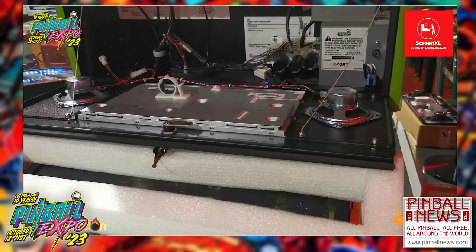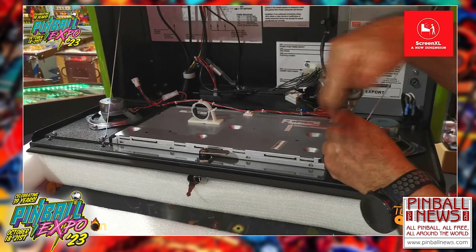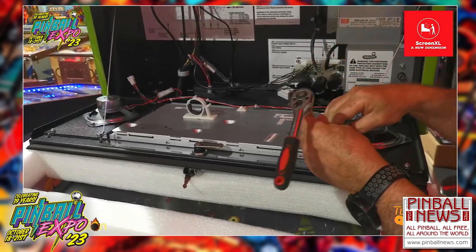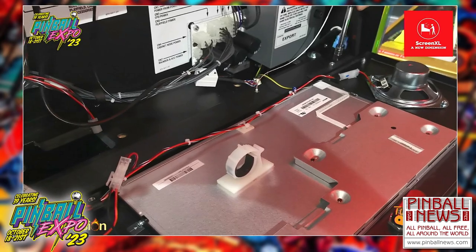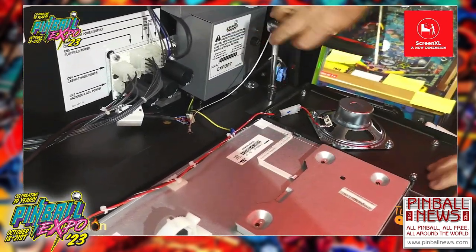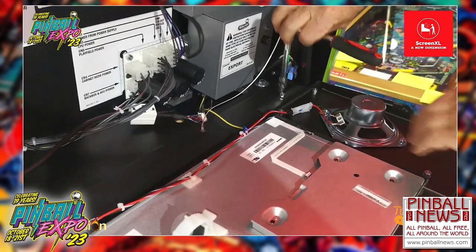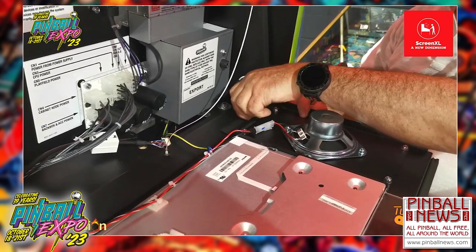And once protected, now it's time to remove the screws that we need to remove, which basically is those two ones that have the tensors of the panel. So we are removing now the two screws that fix the original panel to the back box. It's just two screws, one on each side, and it's important to say that these are the only two screws that you need to keep, actually.